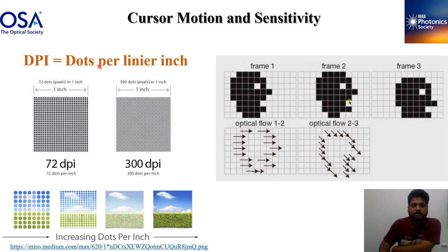These dots play a crucial role in moving the cursor on the screen. Dots per inch, or DPI, is the measurement of the sensitivity of the mouse. If the DPI is less, the movement on the surface required to move the pointer from one point to another is larger. If the DPI is larger, the movement of the mouse on the surface will be less. As the dot count increases, the image will be sharper.